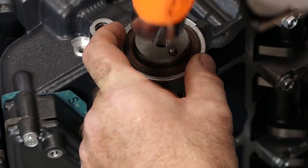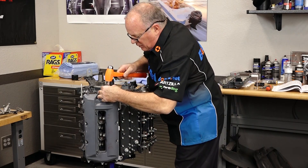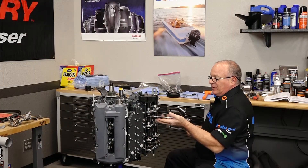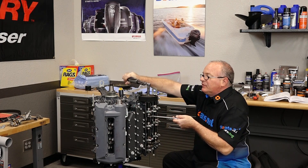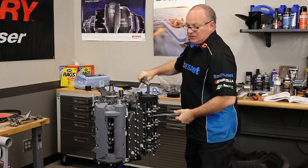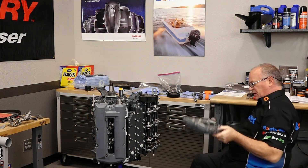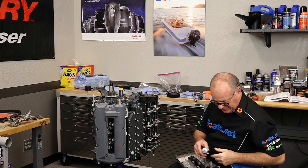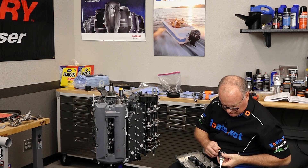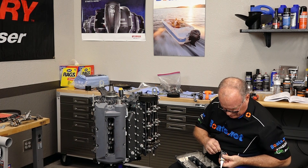Let's start by tapping in our dowel. Since we're at it, we'll go ahead and get both of them. You actually have a 23 millimeter going down to your camshaft and then the top bolt is a 13 millimeter, and we're going to take this to 43 foot-pounds. Yamaha actually wants you to replace these gaskets every time you pull it off — I think that's a little bit excessive, they're brand new. I'm just going to add one little small dab of Yamaha bond in these four corners and pop it right back on there.